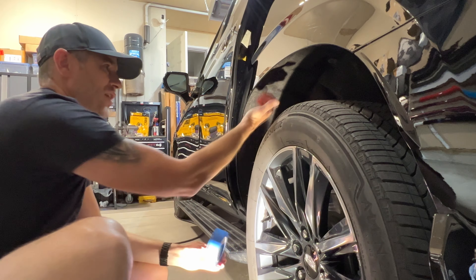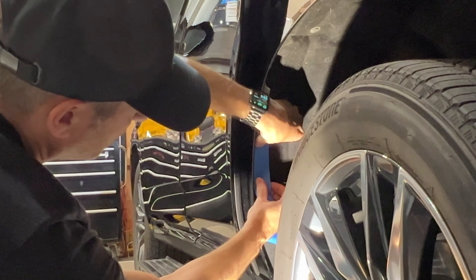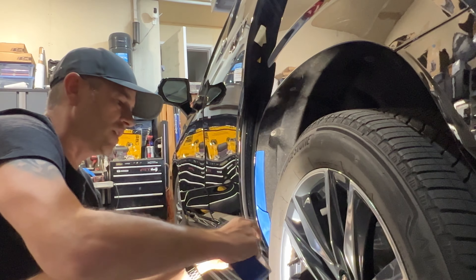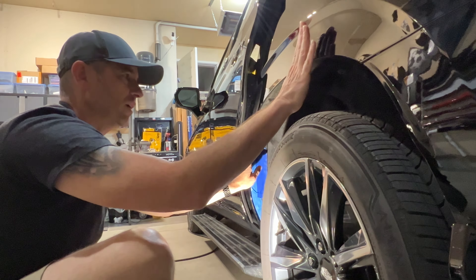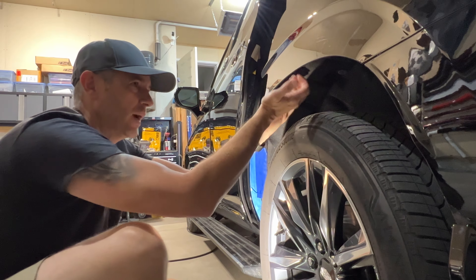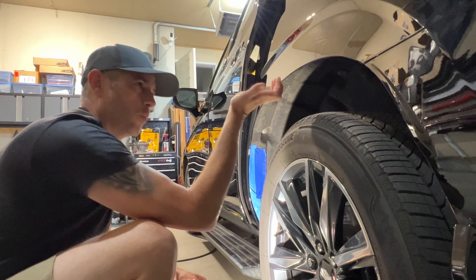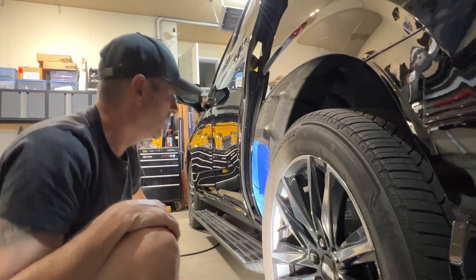Another good preparatory measure: eventually we'll be working around the wheel wells and our material will just tuck slightly around maybe a quarter inch. A lot of these fender wells are made out of carpet material for sound deadening purposes, and when you hit on this carpet the sand just keeps falling out. To prevent sand from hitting our wrap as it starts to curl under, I take tape and lay it up against that carpet edge all the way around the wheel opening. I'll even take a wider tape and go about three inches in, so any dust that falls is unlikely to land directly on my wrap. If sand gets stuck under there, water can channel through and eventually cause the wrap to fail and peel in that area.